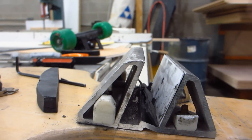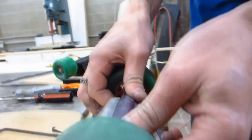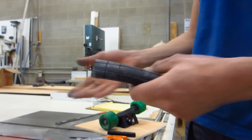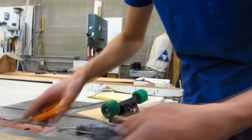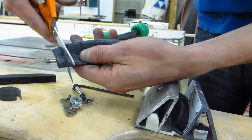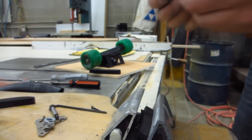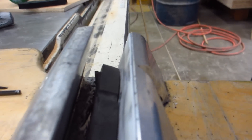Next, we're going to put the cam in here and check how tightly it fits. You can see we get a lot of movement right there. So I'm going to take a piece of bicycle tube — I just bought one new and cut it up because it's really useful for these trucks. You can use them for the O-rings, you can use them for anything. I'm going to cut a section that is shorter than the cam, with the length marked, cutting a little underneath so I've got some room to play with.